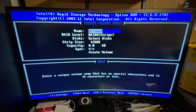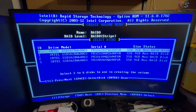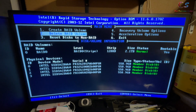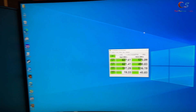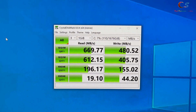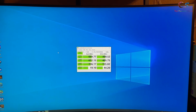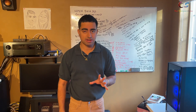We're going to create a RAID volume and call it RAID Zero. Select four discs, change the stripe size to 128, 2.4 TB, and create volume. The results from four drives aren't great, so I'm going to take one SSD off and see how triple RAID 0 works. As you can see, the read speeds are essentially the same and write speeds are only slightly slower. There's definitely a bottleneck, so three drives is about the most you want in RAID 0 for the X58 platform.